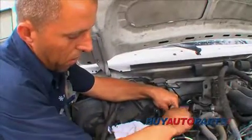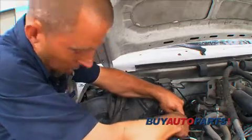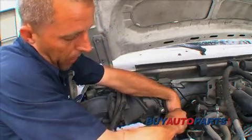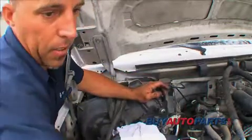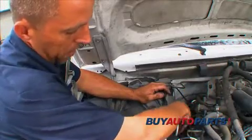The way you know if the Ford spring lock fitting is engaged all the way is to push down until you hear it click. Physically try to pull it back out. If you can't, you know it's locked in place — then put the safety retaining clip back on.